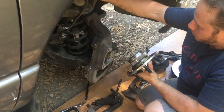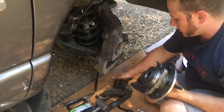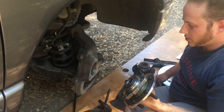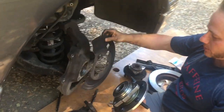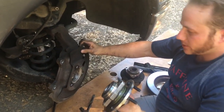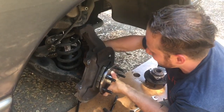First, you also have to take the brake caliper and the brake caliper adapter plate off, which is, I believe, a 19 millimeter bolt, and the other ones are something like 12 millimeter or so, but we'll get to that when I put it back on. So you wanna make sure you put the backing plate so it's conforming to the hub, because we learned that earlier. That's why I have to redo this video. The magic of YouTube. Don't listen to what I say to do.